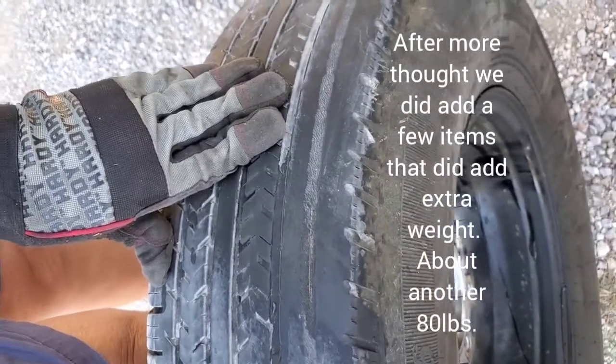And just as an FYI, we put tire covers on the trailer wheels every time we park, especially if it's at least a week. But this isn't the outside of the tire. Something is wearing it. We don't know, it might be an overloaded spindle. Could be a bent spindle. We're not sure. We're putting the spare on, and we only have to drive 67 miles today. Yeah, so we know that we're good to go for that.